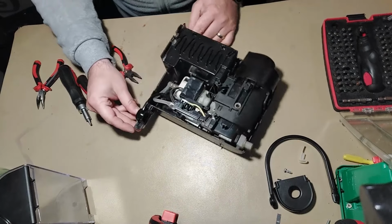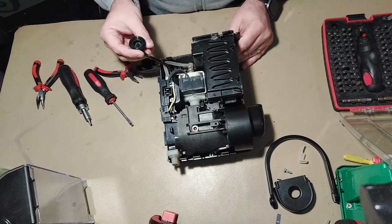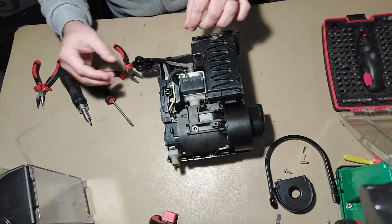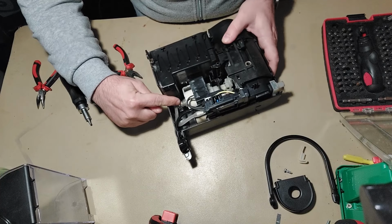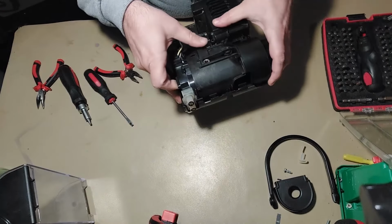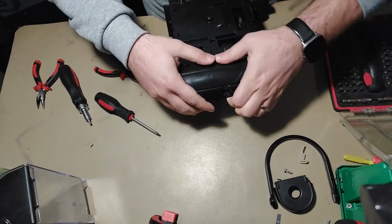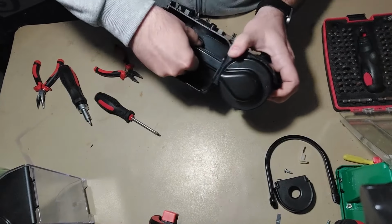Good, so as I said, back side, front side. Here is the water tank gasket or intake. This can be loose, and you can have a lot of water leaking due to this gasket. If you change it, then no more problems. You can have leakage also from the pump. But let's remove completely the entire internals. I think it's easier for us to see. Forgot to remove this.